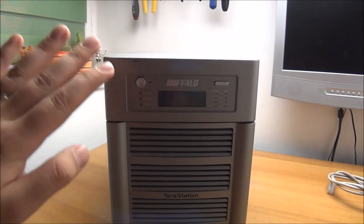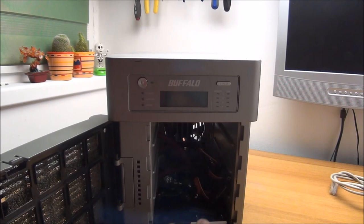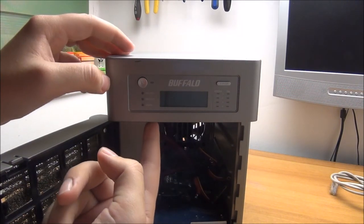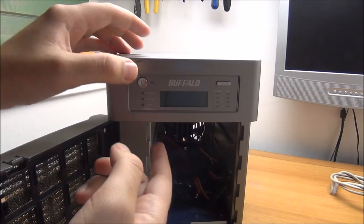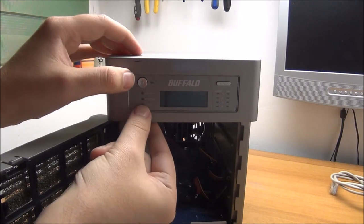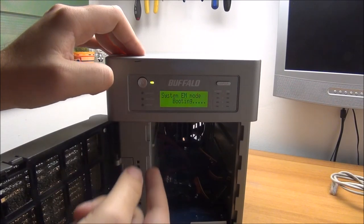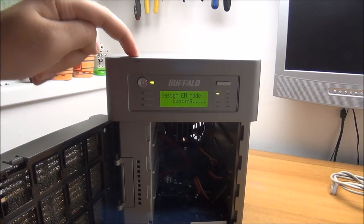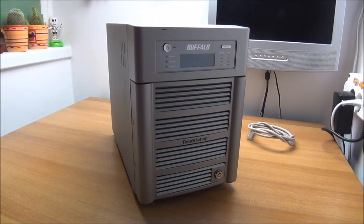If you don't have a problem with your NAS but just want to upgrade the firmware, most of them have a reset switch somewhere in this compartment — maybe here, maybe underneath. This one has one in this area. There are two variants: either you push and hold the reset switch and then power the unit on and it will enter emergency/recovery mode, or you power it on and then hold the switch for a while. For this one I'll try: push the switch and then power it on. You can see it's in emergency mode booting now — so now I can rewrite the firmware even if the unit is 100% working and not broken. And it's finished — not perfect but way better than it was.